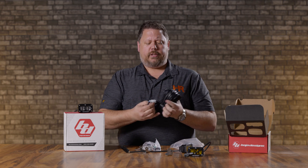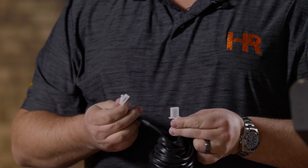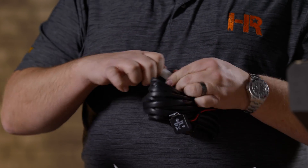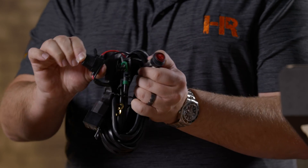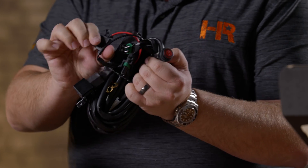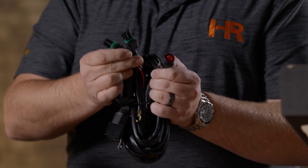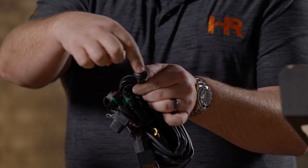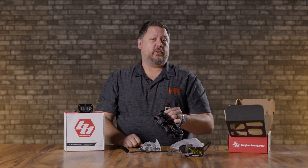The connection for the switch is also not waterproof, so if either of these connections are exposed to the elements, there's a pretty good chance they will fail over time. The other components of the harness include the fuse holder — your standard water-resistant type — the two connectors that plug into the pod lights themselves, which are high quality and waterproof, and a little red light-up rocker switch that's a standard plastic switch you might find just about anywhere.